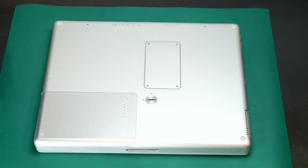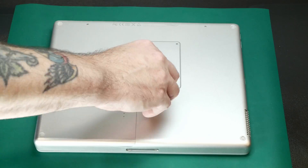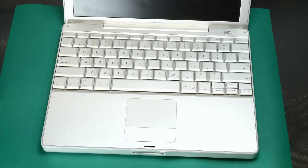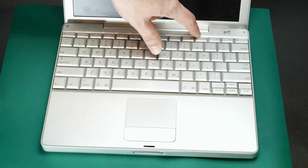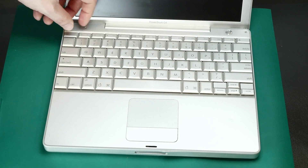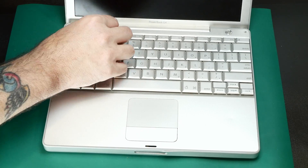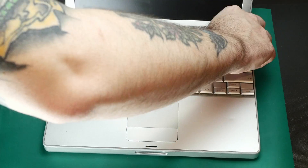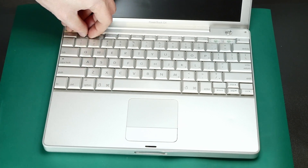Now let's switch to hard mode and tackle this hard drive replacement, for which we have our secret weapon — a detailed iFixit guide. Now the most hair-raising part of this disassembly is that we actually have to pop off four keys to get to the two screws that hold the keyboard down to the chassis. So we have to pop off F1, F2, F11, and F12. Here goes nothing. All right, I don't think I broke anything, so that's good. And then there are little stickers covering the screws here that we have to peel off.